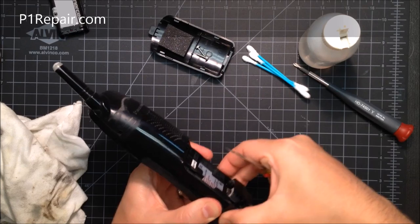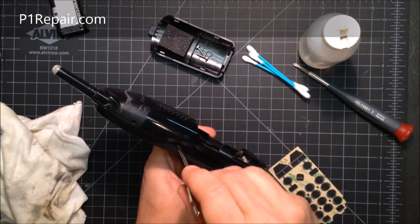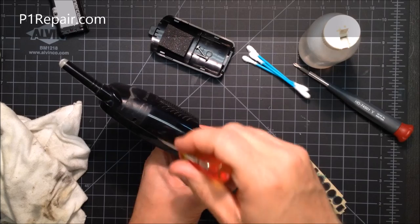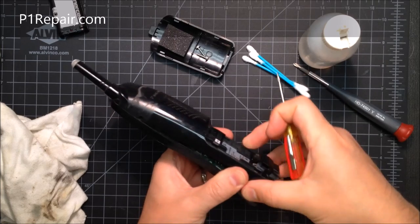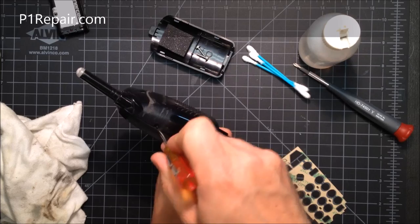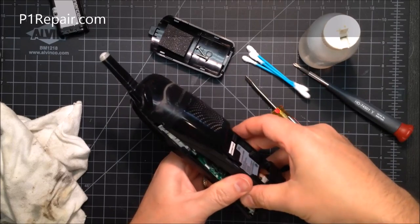This one's a little stiff, so I'm going to put a flathead screwdriver in there just a little bit. You don't have to apply much pressure — just put the pressure back here and it'll unsnap. Gently wedge it up. You don't want to be shoving the screwdriver in there because you'll scrape across the circuit board.